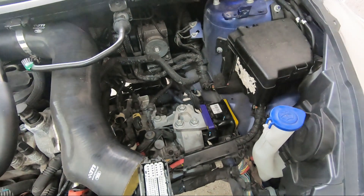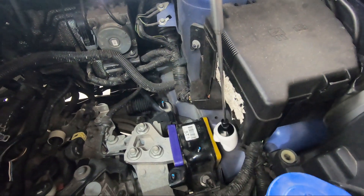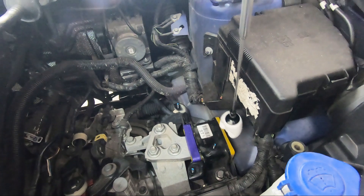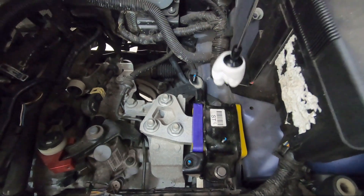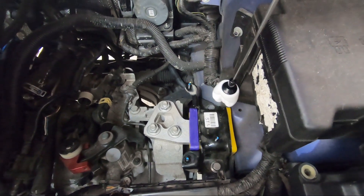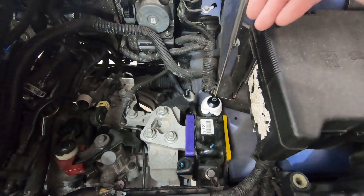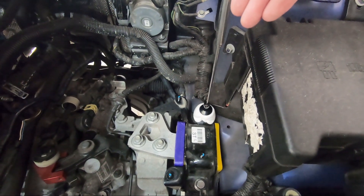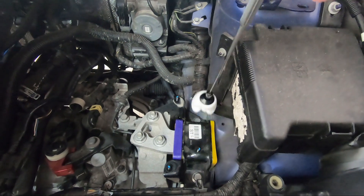We're just going to put the battery back in and the airbox. As you can see we've got the little locking piece — the purple piece — and Mitch has greased up the face of the yellow piece here just because it rubs up against the body. A little bit of grease on there is going to stop any squeaks. Another tip from Mitch: the bolts that go down into the chassis, do them up by hand first — not only to avoid cross-threading, but the threads in there are only tack welded in, and you're going to have a bad day if you go straight in with a rattle gun and break any of those tack welds.